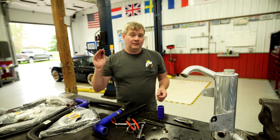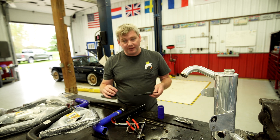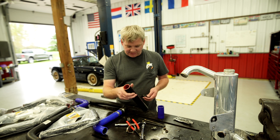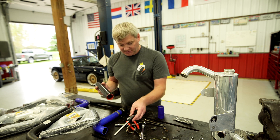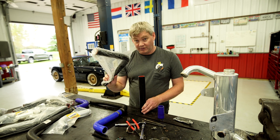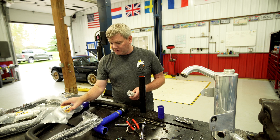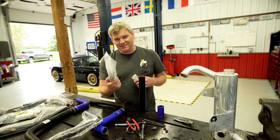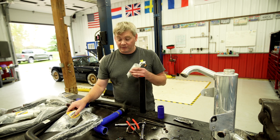As suspected, the thermostat outlet housing is inch and a half. We'll make the upper radiator hose work with some creative hose adapting. I'm going to lop off a piece of this silicone hose — this is HPS brand hose. Not a sponsor of the show, but reach out if you want to be, because their stuff is amazing. I've got it in the Datsun project pretty much exclusively, and this is my go-to for the TVR as well. These little aluminum radiator pieces are theirs too. The only thing I had to get from Speedway Motors was an aluminum 90-degree bend, since HPS doesn't make those.